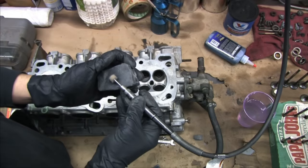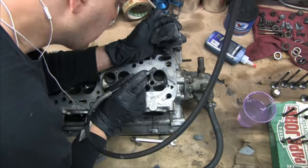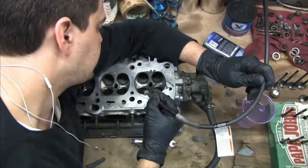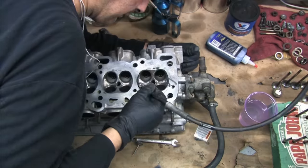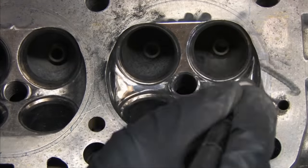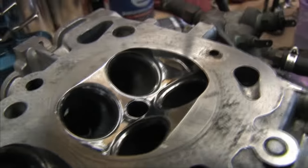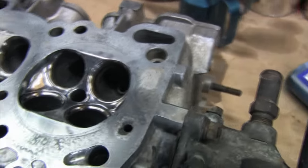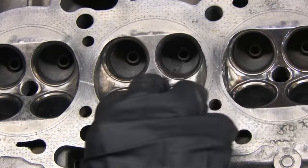For the polishing process, I'm using my Dremel with a flex shaft attachment, felt polishing wheels, and black emery rouge. Black emery rouge is a coarse cutting compound that's very aggressive because it contains an abrasive. It makes short work of dull aluminum parts, quickly producing a bright luster, but it will leave fine microscopic scratches on the surface. If you want to completely remove those microscopic scratches, you would follow this up with white diamond rouge on a new clean polishing wheel.